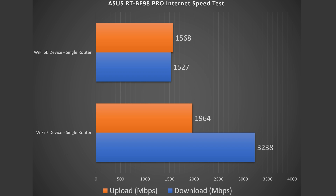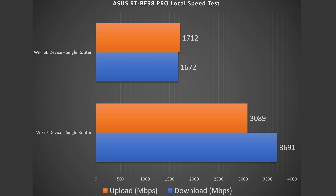To find the true performance of this router, I do a local speed test server. I make my computer into the server and go from Wi-Fi device to router to computer — getting rid of my ISP and the public speed test server from the equation, really just isolating this thing and testing its signal. There is an improvement in speed, especially for the Wi-Fi 7 upload section — a huge increase, just under 3.1 gigabits per second. Wi-Fi 6E saw less of a gain, but still getting really good numbers.